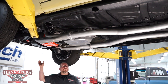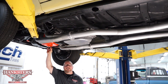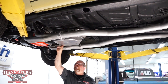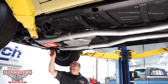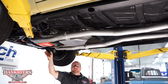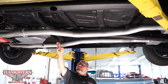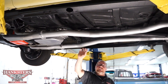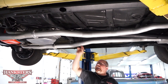Coming in towards the center of the car for the driveline — this is an all-original numbers-matching car with a 396 cubic inch big block Chevrolet motor, numbers matching. Back behind that is a Turbo 400 automatic transmission. Looking at the pan on the transmission as well as the engine, those are dry — basically leak free. It also has the flywheel cover on the bell housing to help keep debris from chipping a tooth off the flywheel. The transmission cross member is good and straight — a tubular, factory-style member bolted in from frame rail to frame rail. The tail shaft mount looks good, and the seal where the slip yoke slides in is nice and dry.